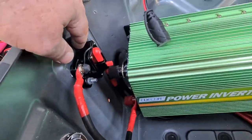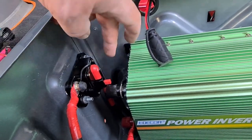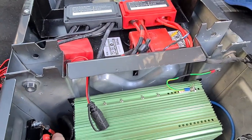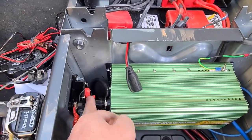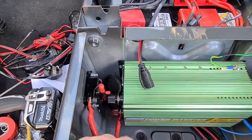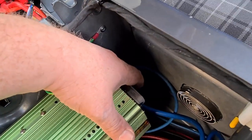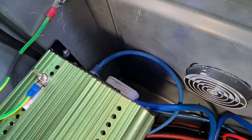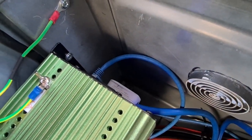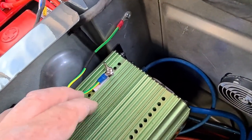I'm going to make a little cover to cover this switch — these terminals are a bit too exposed for me. All live comes from the battery through the switch onto the inverter. When we switch down here, you should see the blue light come on — that's the display on and that is the inverter working. The case is earthed to the chassis, so if anything goes wrong inside it, it should blow the fuses inside it. That is not the earth for the system.